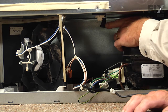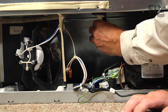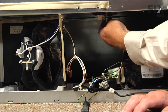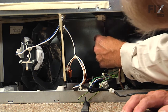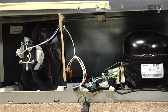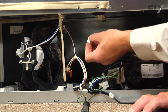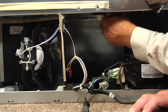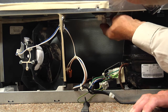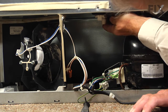Now next, you may have this little duckbill valve attached to the drain outlet. We'll need to pull that off and discard it and then just make sure that that opening is clear. We'll take the adapter that came with the kit and we're going to fit that over that spout and we need to push that all the way up until it is flush with the sealing in this area. It takes a little bit of maneuvering because it is fairly tight.